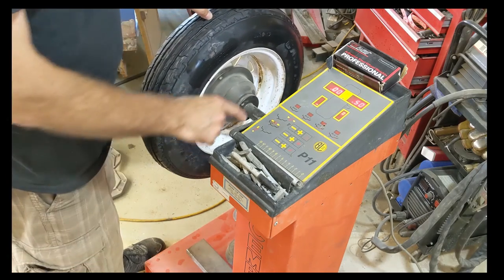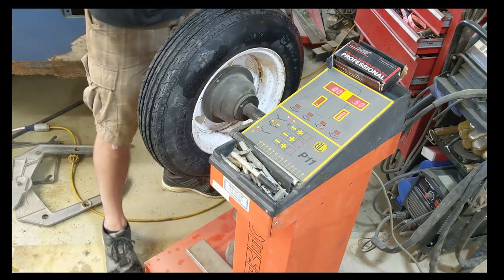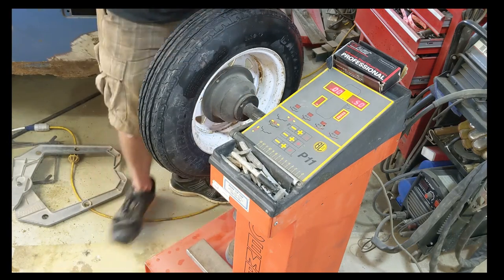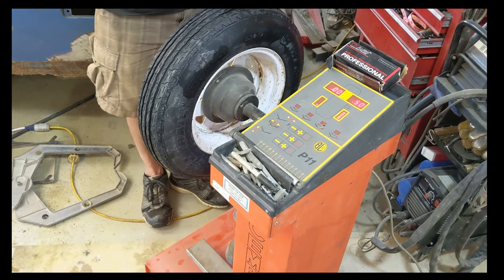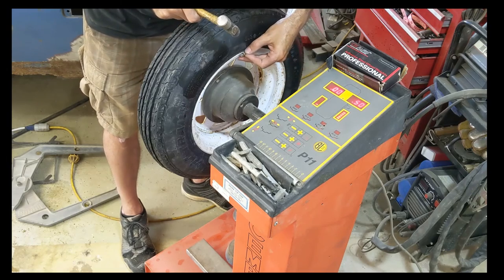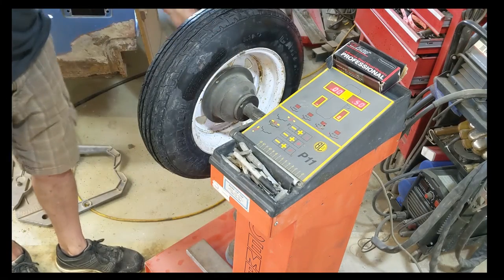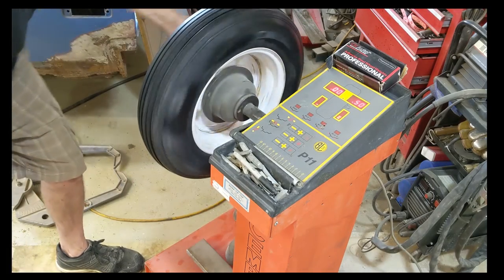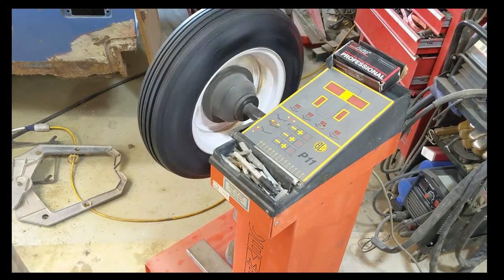What you do is find the spot — that right there tells you right above the shaft. I need a little hammer here. I got a little ball-peen hammer. So a half ounce, right above the shaft. Let's see how she fared. Spin her again. That's actually not bad — the other one I did was out two and a half ounces on the outside. Look at that — zero, zero.